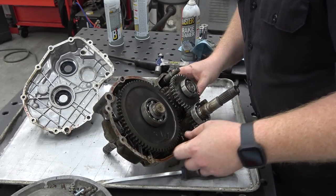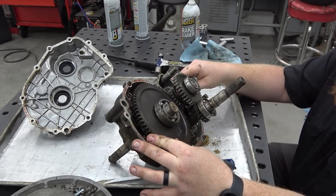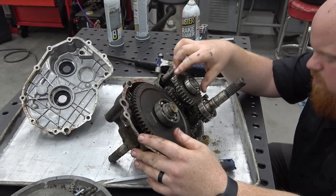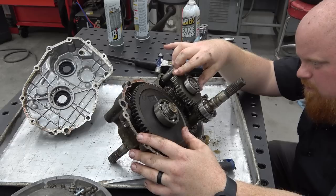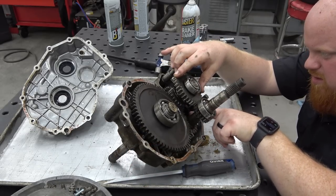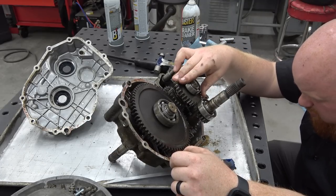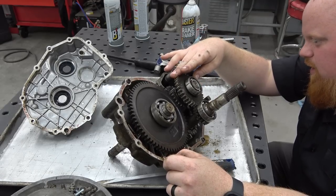I'm not quite sure how this whole thing comes apart, but it's actually way cleaner than I thought. The main spline looks good, the main spool — whatever you call it — this gear looks good. I'm going to spin it — it was skipping teeth. Everything looks really good in here, there's not a single worn out gear. I'd rather take this thing apart and know everything's good instead of just assuming. There's a nasty looking chain tooth with some rust, probably where water set in, but the chain looks good.